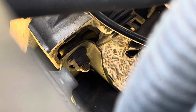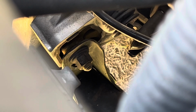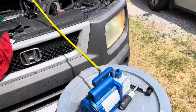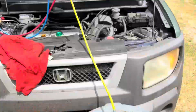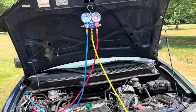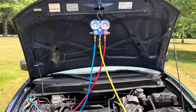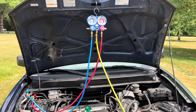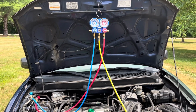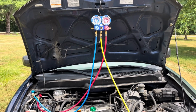Once the subframe's completely bolted back up, it's time to put the front motor mount bolt back in. I had to wiggle mine around to get it to go in. Once the compressor's installed, we vacuumed down the system. This entire vacuum kit cost $100 off of eBay, and that's going to suck all the moisture out of the system. I'm not going to go into a huge amount of detail on this. Instead, I'm going to put a link to a video that I think is probably one of the best ones done by Chris Fix. That's going to be in the description. Check that out.